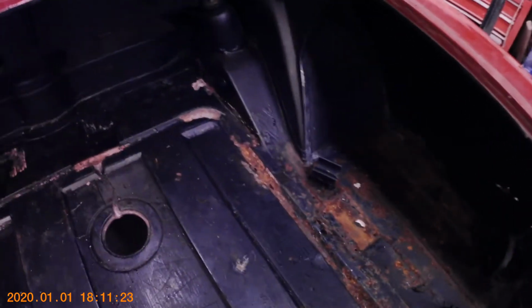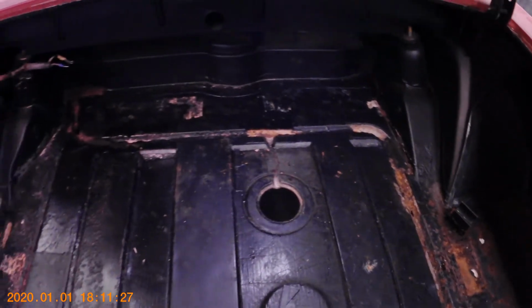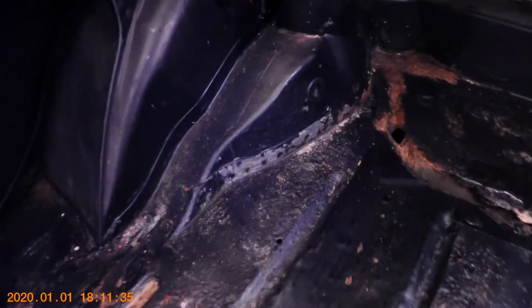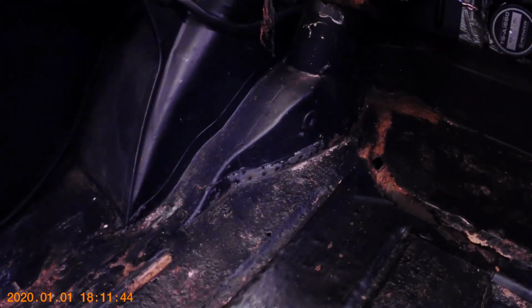I'm going to start on this here in a minute, but I just wanted to talk briefly about the different ways that you can take these pans out. They're all spot welded in. And you can see here where I've scraped some of the paint away, where the little dots are, where the paint stays, that is where the spot welds are. So you've got all these little spot welds that have to be taken out, and there's several ways that you can do this.